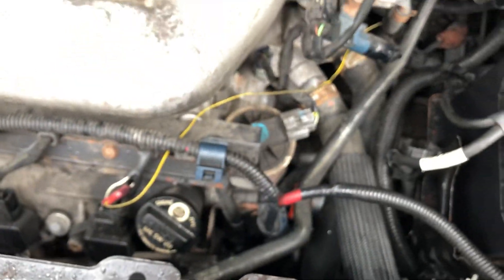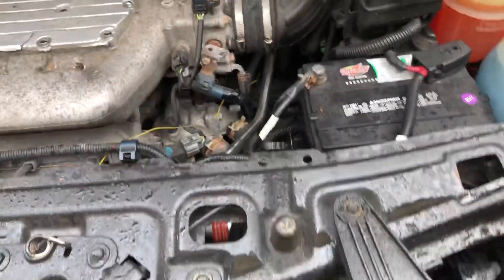To make your life easier, take the battery and the battery tray out — it'll give you the room you need, which is still barely any. That's where the starter is. I'd get on the ground and show you from underneath, but it's wet.